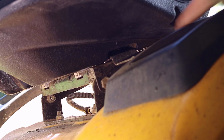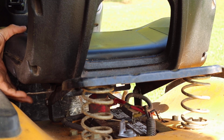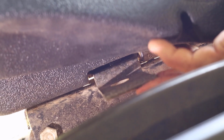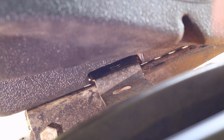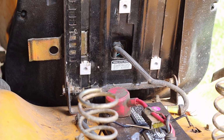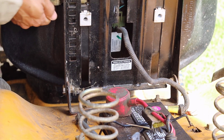The seat lever is held while the seat is pushed back into place. Here are other views of the seat lever and the compression spring. They were tested multiple times since they need to function properly with the seat. It seems obvious, but it's good to triple check since the operator is going to be on a moving vehicle with moving blades. The seat was again lifted to give better access to reinstall the fastener.